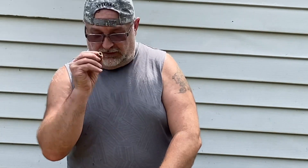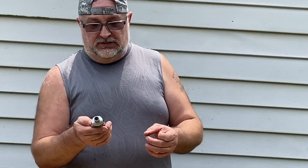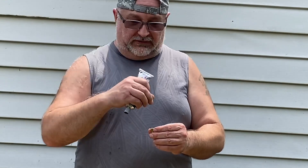The other thing that we did to keep water from coming through the threaded insert was we took the bolt and used some black silicone — Permatex is what we used. We put it around the bolt and put everything back in, tightened it down. Problem solved. That's how we did it.